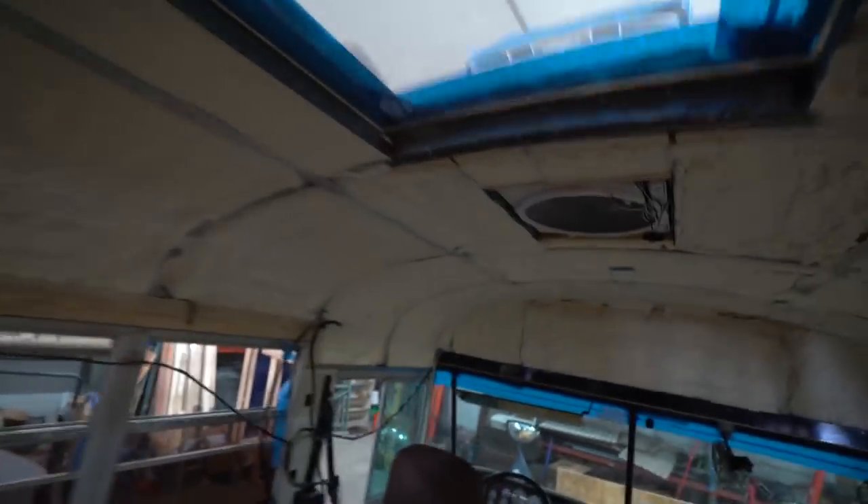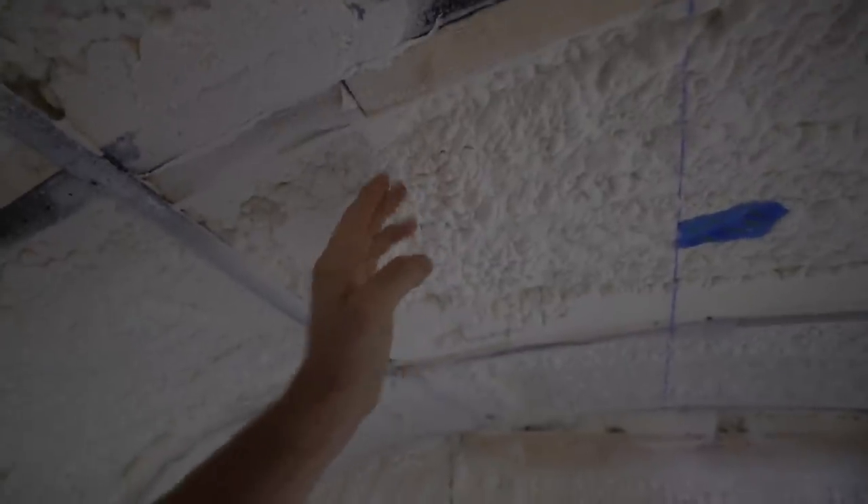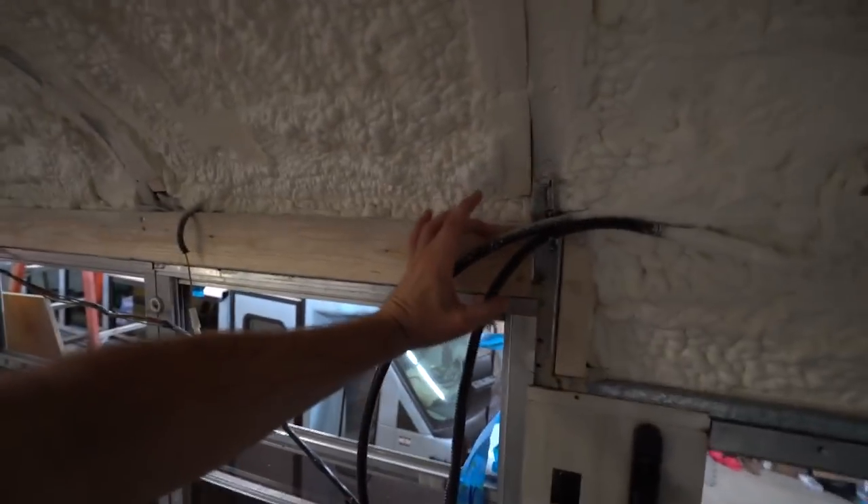So we need to figure out the wiring first. We also need to figure out the solar combiner box — it'll probably be bolted here, and then the panel starts here but we'll drill in over there. We'll have on the roof a wire going across and down that way we don't have to go through this. In a perfect world I would have already had this thing wired, but since this is only my second bus and I'm still learning, there's a lot of things to learn. Learn by doing. It comes down, we're just gonna run it down to here, drop the whole bundle on the side, and make a little wire chase in the middle and run it all the way down. You can't get too far ahead of yourself on these things because it's really easy to mess up — just like when you have a skylight and then start putting a deck over it. You gotta plan for things in advance, and as the saying goes, you never know what you don't know.